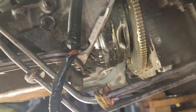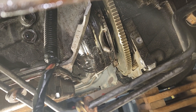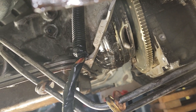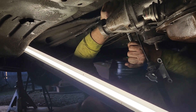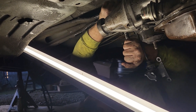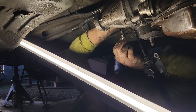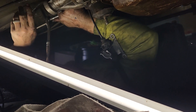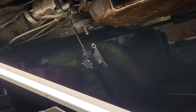We're going to need to get some shorter torque converter bolts. We've got a UMI turbo 350 crossmember that has the torque arm mount on the crossmember itself. Then we're going to have to drill holes for his shifter linkage to get it to line up, but we are going to use the stock shifter.